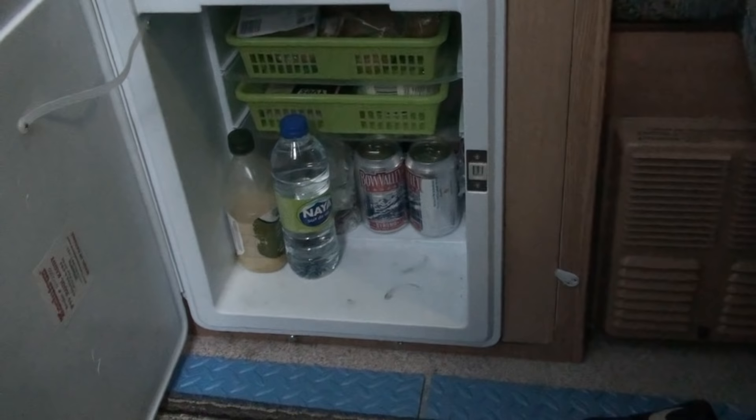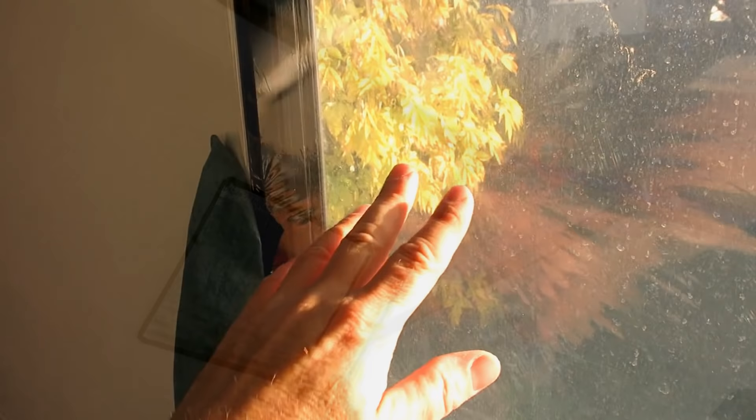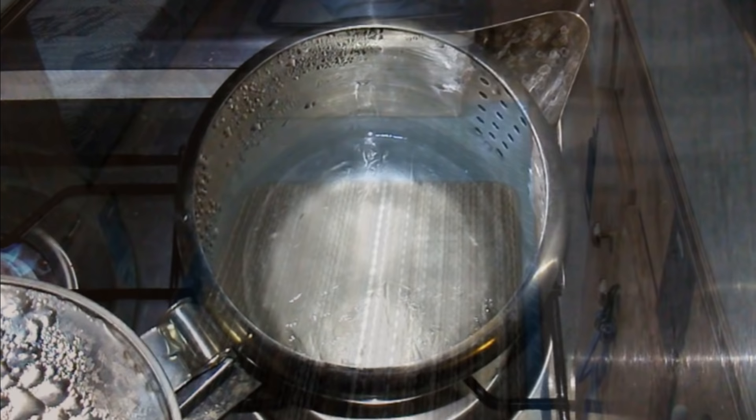So to summarize: I've now added carpet to the roof base and hinges, foam in the gaps in the sides, added vent covers, inserted baffles in the roof peak, added window barriers to all windows, and rubber weather stripping in the door. After adding a moisture absorber, floor mats for insulation, and protecting water from freezing, I think it's time to go camping.